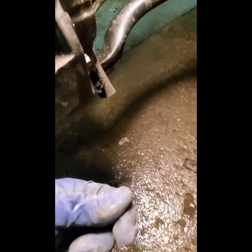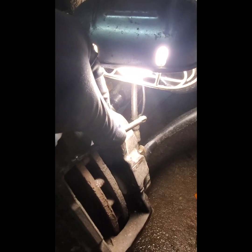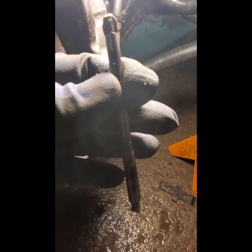Just a heads up, these are what the pins look like. It's just a press pin, but it's got this bulb end on it. So it may be stuck inside the inside portion of the caliper, because remember, you're striking it from this side, pushing it that way. So this bulb end is going to pop out like in that fashion, okay? So when you put it back together, make sure you clean this. Do yourself a favor, clean all this up. And a little touch, I mean a little touch of anti-seize wouldn't be a bad idea either, okay?